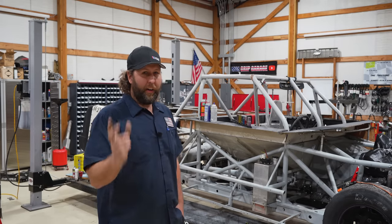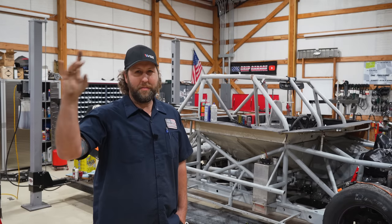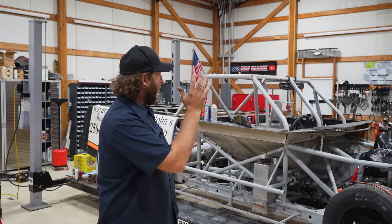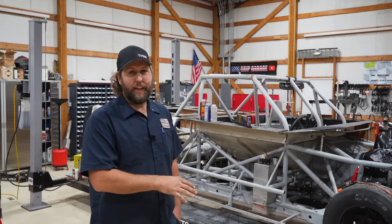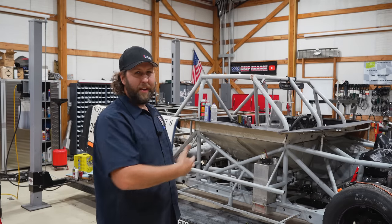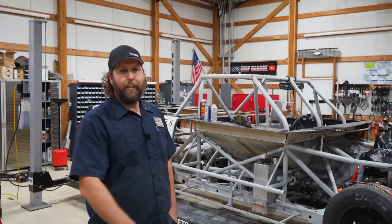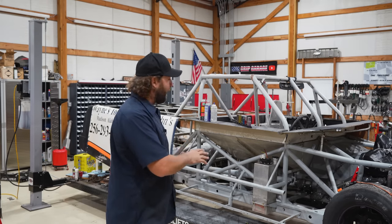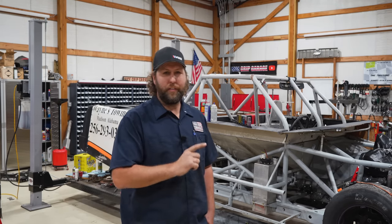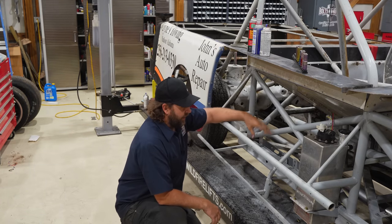There's a lot in the planning and just trying to lay this out correctly. We've got a Holley Terminator X — that's the brains of the unit — but we also have a relay bank because we're going to be putting some switches in to control things like the fan, the ECU, and the ignition. Then we've got some solid state relays, a battery charger brain box, and we've got to mount it all. We're going to start by making some mounting places to put all of this stuff in. I'm thinking of putting the brains right here — I've got to make a plate first.